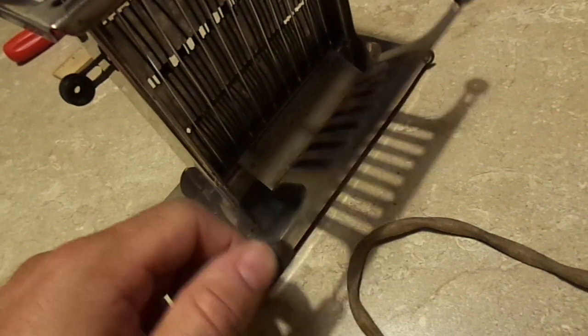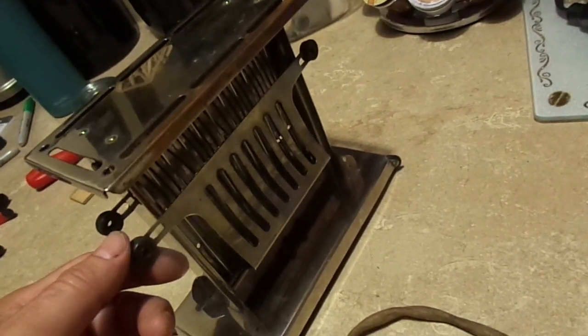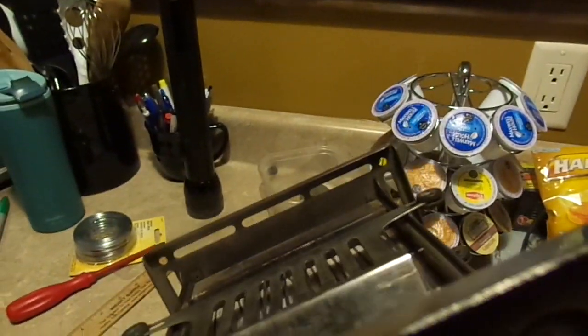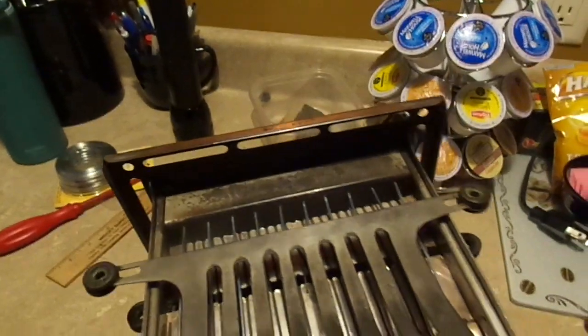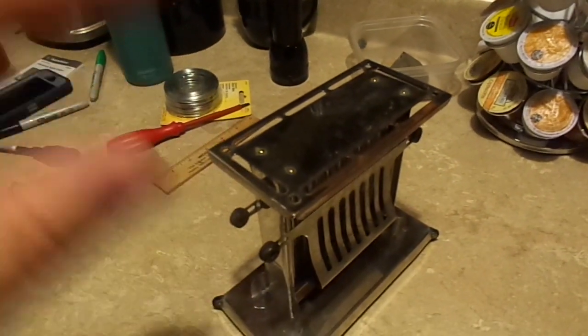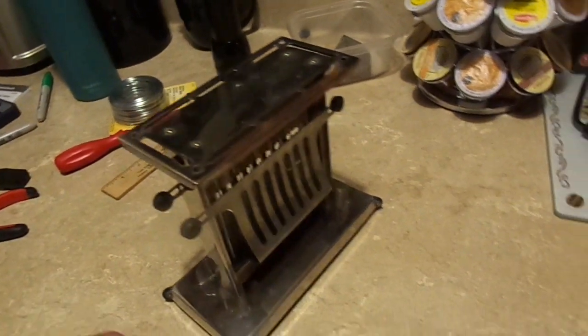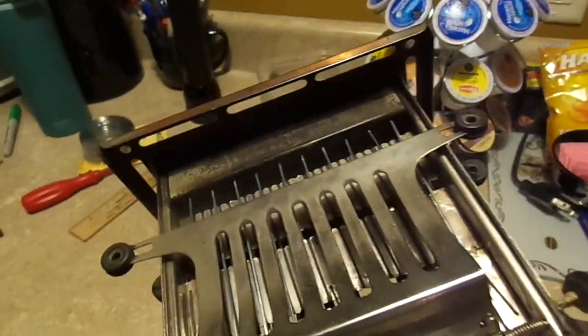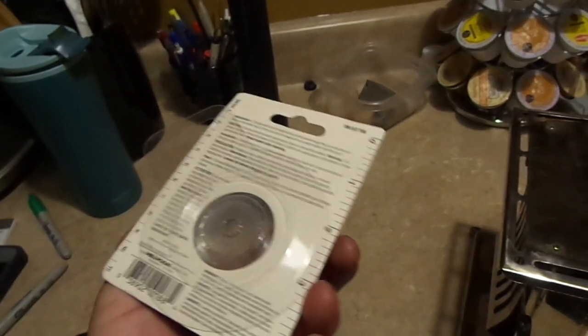At least it was on this toaster, not one that was in better condition. The plating is completely worn off the top — I didn't polish the top; it came like this — and I just made the base match it, giving it more of a satin appearance. In the future I'll still use metal polish, but I won't use steel wool — I'll find something softer. The plating is also ruined on the doors — burned off on the inside from being left plugged in for a long period. It shows signs of actually catching fire. There's a lot of what appears to be heat damage, more than likely from a bread fire. It was very ashy inside. I replaced the vertical stakes that hold the bread away from the elements — when I got it, it was missing two, so it only had eight; it requires ten. Those I had to make from galvanized wire.